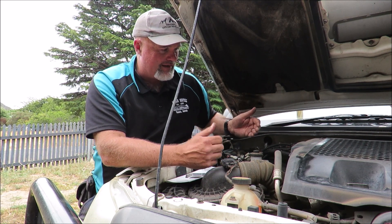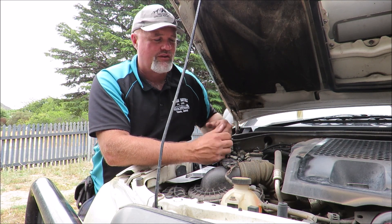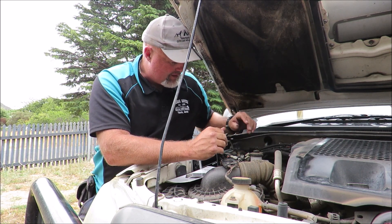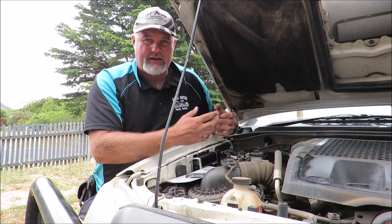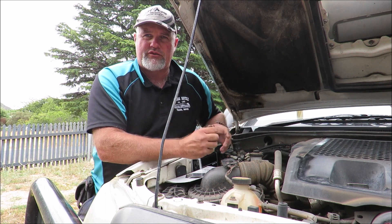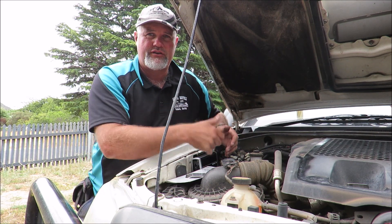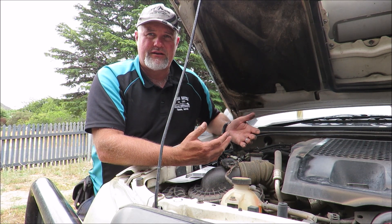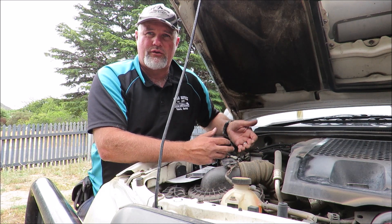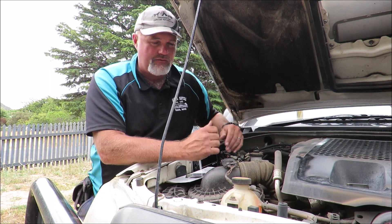The only thing that was a bit of a pain was joining the cables, as I've got pretty big cables coming from my batteries. When using a 25 amp DC to DC charger you can get away with much smaller cables, but I didn't want to run new ones so I kept the thicker ones. The C-Tech in the camper trailer just comes with posts — almost like battery posts — where you put a lug on the end of the cable and screw it down, which works really well and is how most dual battery isolators work. This Projecta unit comes with a cable already attached, which I found a little bit of a pain because I needed to find a way to join my existing cables to it. It wasn't the end of the world, but it would have been easier if there were some sort of lugs. Not a deal breaker, but worth mentioning.